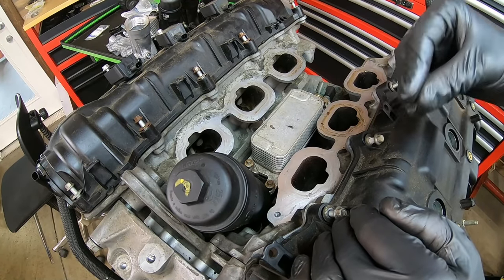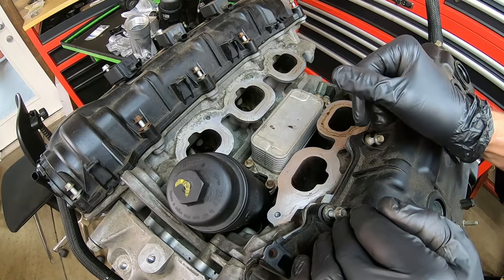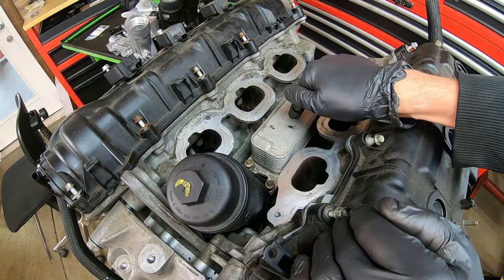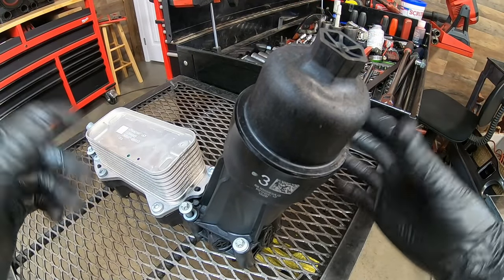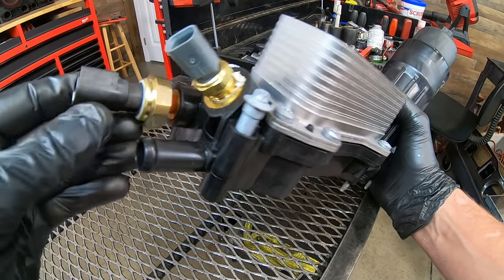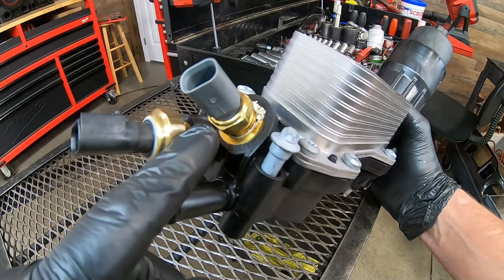What you usually do if you have a 3.6 and someone says it's leaking oil — this is the first place you go. Obviously, we have coolant going through this cooler, and that's another place where it can leak. There are some O-rings where the cooler is bolted to the assembly, and that area can fail. We'll get coolant down in this area as well — not just looking like an oil leak, but a coolant leak coming out in the same area. Another thing is the cooler itself can fail internally. When that happens, if you look at your antifreeze, you've got oil mixed inside. Here's a close-up of what the assembly looks like off the vehicle. Inside you've got a cartridge-style filter with an oil filter cap and O-ring. Right here is your cooler portion, with the hose connection where the coolant goes in. You've also got an oil pressure sensor and an oil temp sensor. We've had issues with the oil pressure sensors over the years, either reading incorrectly or leaking out the electrical side. The oil temp sensor — I've never had one fail.